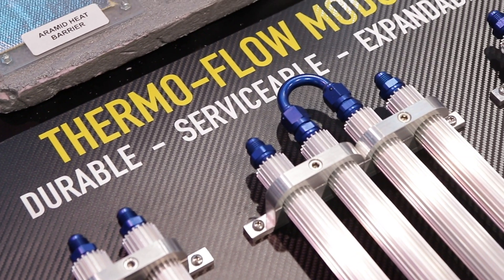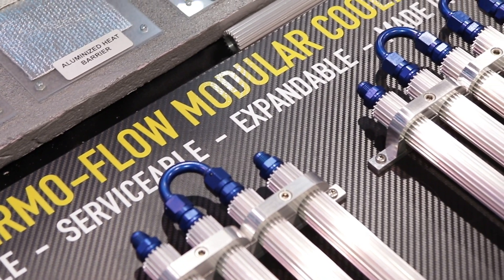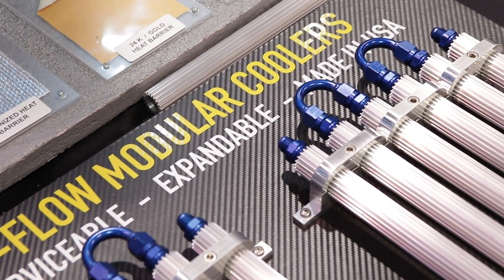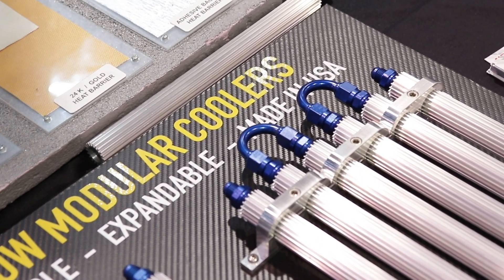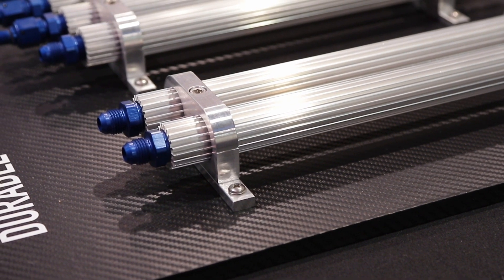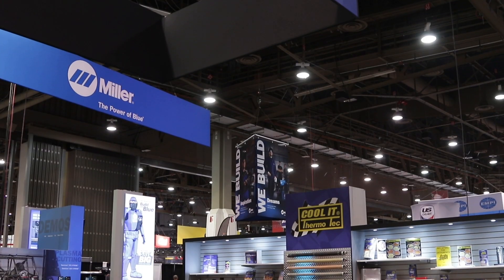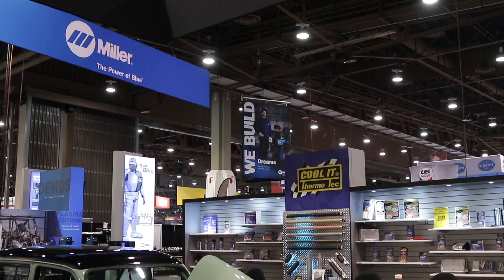I like it a lot. I've seen ones with just one big fat tube, but this is the first time I've seen this because you get a whole bunch more surface area with the smaller tubes, and more surface area means bigger cooling. Yeah, and there's actually extruded fins on the inside as well, which is one thing that nobody else has done. So it pretty much just sucks the heat straight out of the fluid. With the two tube cooler, we saw up to 30% cooler fluids coming out than going in, and with the four tube up to 40%. So just as many as you want to add on, you can cool anything any amount that you want.